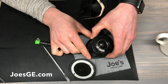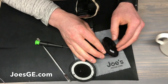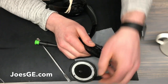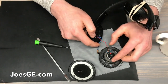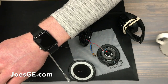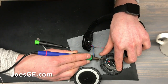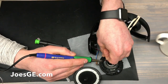Now we have all these unscrewed and all the wires exposed on the inside. Get the rest of these screws out — now you have access to all the wires. You have the opportunity to desolder these; make sure you put them back in the same exact order. Get your soldering iron, tin the edge, and desolder. Make sure you're nice and quick. Now we have them desoldered. Make sure you follow the same steps and get these soldered back on as you reinstall the speaker.